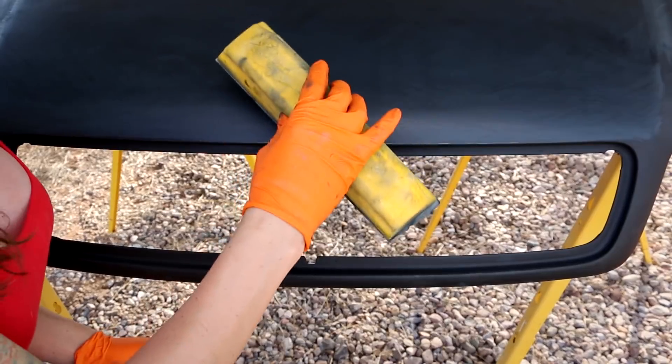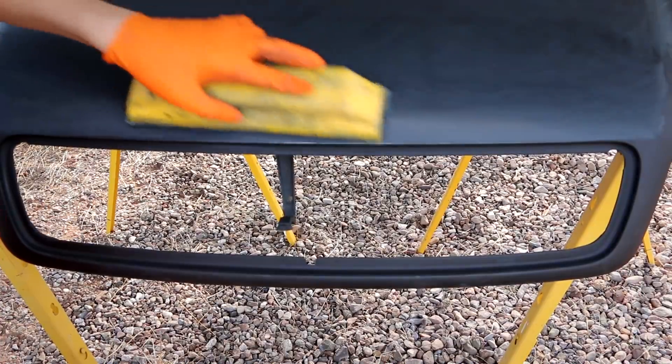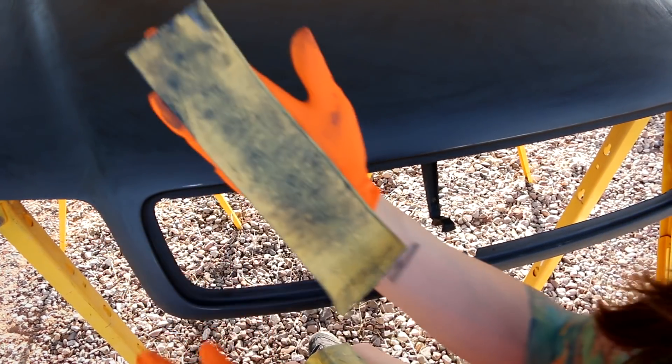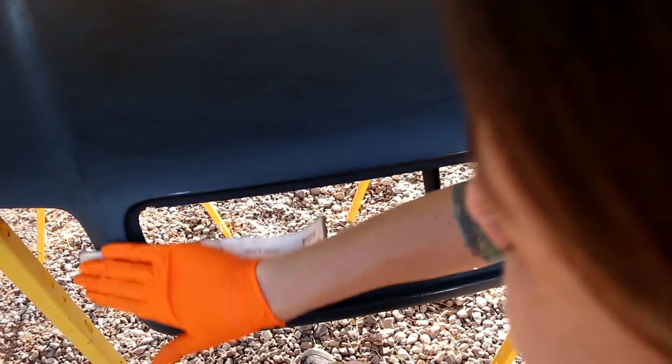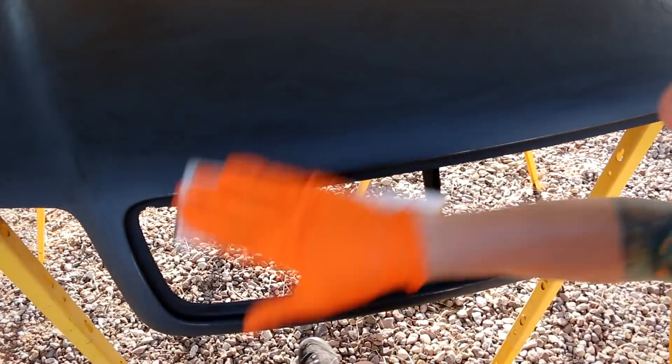I started sanding a little bit of the hood. I want to show you guys what I'm looking for to find the high and low spots. You can see right here I have a low spot or inverted pimple on the hood, and over here in the front I actually have a high spot where that dent was - it's just slightly high. I'm probably going to have to knock it down with a body hammer. For these areas around the edge of the grill I have hand paper stuck to my hand and I'm doing those areas by hand - it's a lot easier than using the big block. Just kind of going over them all, smoothing it out.